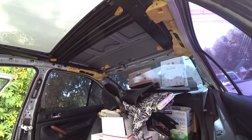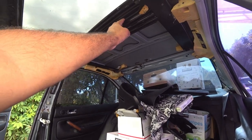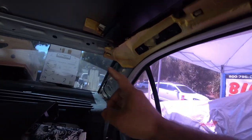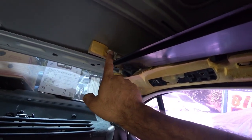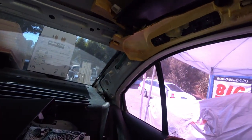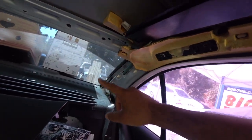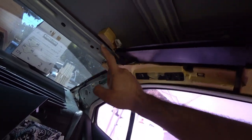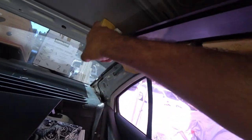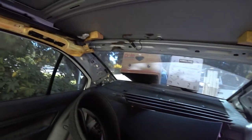To remove your sunroof cover, you pull your sunroof all the way back, and once it's all the way back it's going to stop and hit these stoppers — leave it there. Next step is to pop out the rear drain brackets right here. There's one here and there. Depending on the generation of your Mark IV or year, they're just two little clips and they pop out. Some of them will have a screw on the underside, and to get to that you need to make sure that this rail is hanging — not off, just hanging — so you can reach it with a 90-degree screwdriver. If not, you're never going to get these clips off and you're going to end up breaking them.